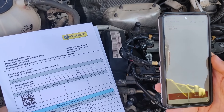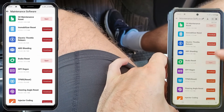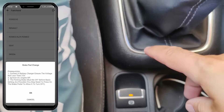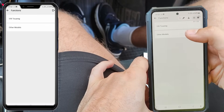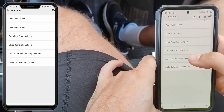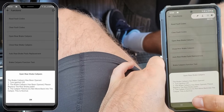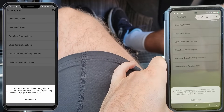I'm most curious about one more thing — whether it can retract the spindle in the caliper piston for brake pad replacement in cars with electric parking brake. I'll go again to maintenance, then brake reset, Volkswagen, then I'll deactivate the parking brake as instructed. Then I go to other models, parking brake, and open rear brake calipers. As you could hear, the spindle retracted and we can proceed with replacing the pads. After replacing the brake pads all you need to do is select close brake calipers.